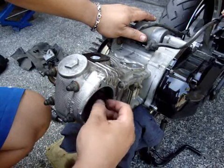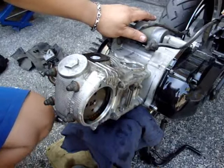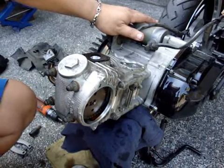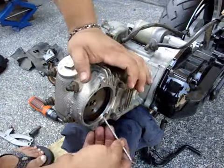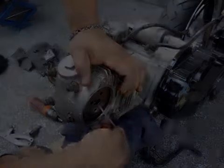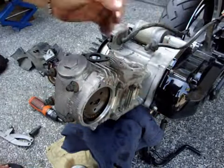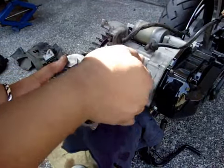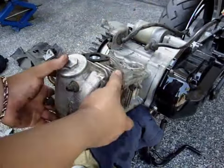Okay, so after that you might want to take out the bolt and the washer wheel here that holds the cam gear, and then after you take that, you just use something to pry off the wheel. Remember, it's in timing, and when you do that, it comes off like that. You just use the 8mm nuts and bolts. You take them off.